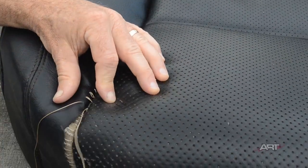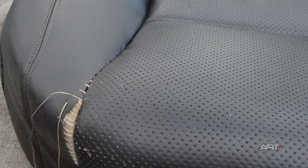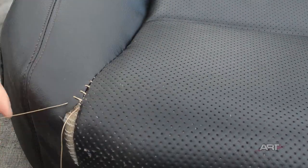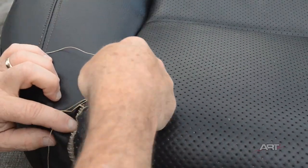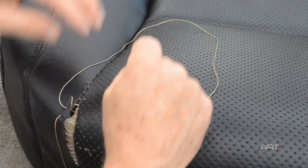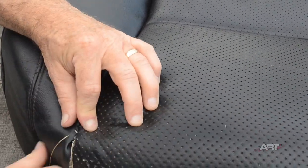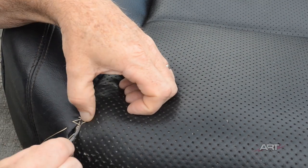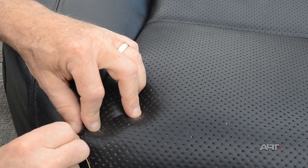Notice as we're stitching along, we're compressing the seat to relieve the pressure. This way, of course, we don't rip the hole right out through the edge of the vinyl. What I fully anticipated here is that this stretchy vinyl would cause the holes to open wide or elongate, and if they do, you will see this lighter color thread in there. And as we get along, I'm sure that's going to happen. Even now, you can see some of the thread there in our finished stitch line. And now I have thread on one side that's not necessarily going into the exact same hole. It sort of misses the hole a little bit and spreads out the thread. So I'm going to back up, pull that out, and make sure both threads are in this exact same hole as much as possible.